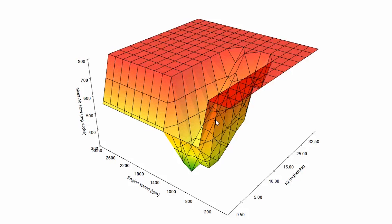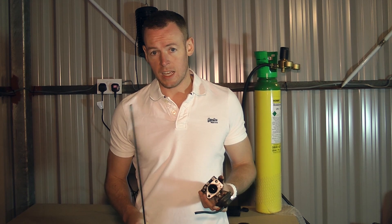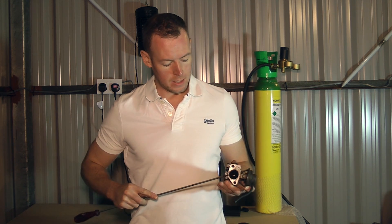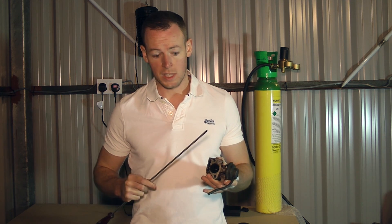But in most modern cars you now need to do a mixture of the two. The glory days of just being able to remove and blank off the pipes — those days are kind of gone. So one way or another, we've reduced the amount of hot recycled air and the amount of oily crap and debris that gets back through the inlet manifold of the engine. Either by mapping it or by removing it, this piston goes in and out less, which means you get more cold air into the engine.